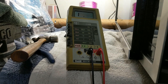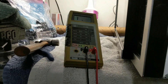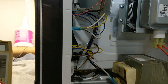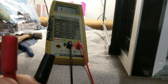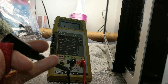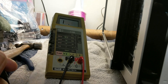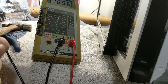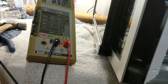So here I'm going to test the door switch. That's one of the things that was suggested when no heat is happening — the door switch, the high voltage capacitor, and the magnetron. The door switch is the easiest one, so I'll try that first. This is a multimeter. Right now the switch is open and it reads one. And if I touch these leads together — the switch — it's just intermittent. There it is. Zero. That's when the switch is closed.